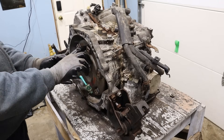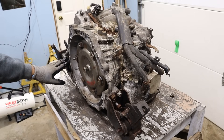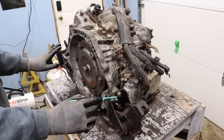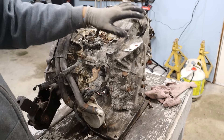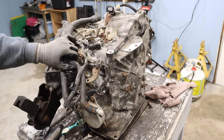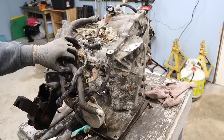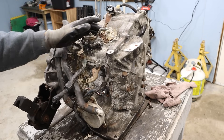Taking a quick look around here, this is the input side where the torque converter is — the engine would bolt up to here. We've got our passenger side axle and our front and rear transmission mounts. Around the back here, there's another transmission mount that would bolt up here. Toyota really didn't want this transmission going anywhere. Around the side here, we do have a transmission cooler. And at the top here, we do have the park neutral switch, which is where the shifter cable would connect to.